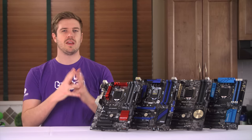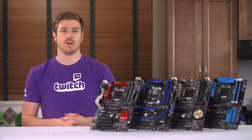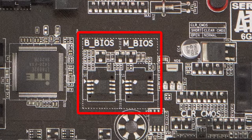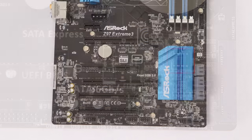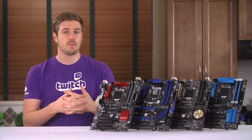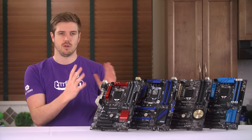But whether it's during an update or something else, what if your UEFI BIOS gets corrupted? How will you recover? Luckily the Gigabyte board comes with dual UEFI BIOS support, so you can easily just switch from your corrupted one to a fresh new one in basically no time. Also noteworthy is that the ASUS board and the ASRock board have swappable BIOS chips, which may be a little annoying as you would need to contact a manufacturer for a replacement, but at least it gives you the option of repairing your board, while MSI includes no actual other safeguards.